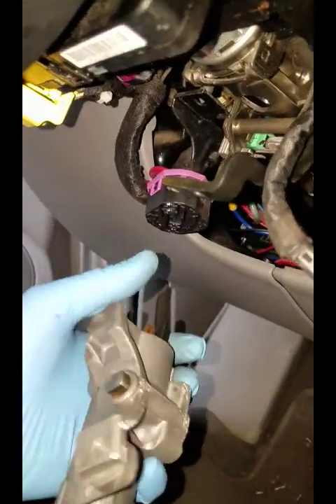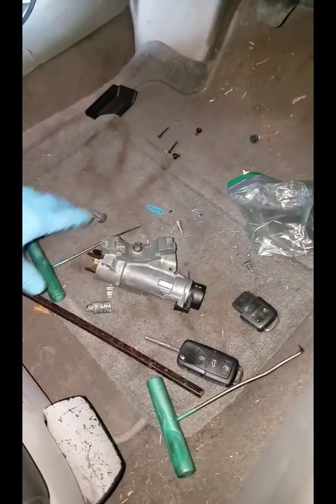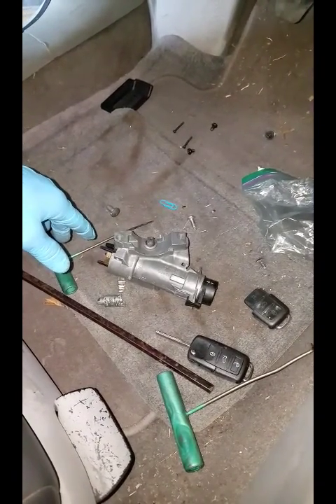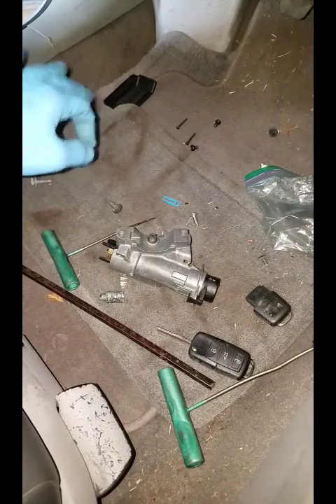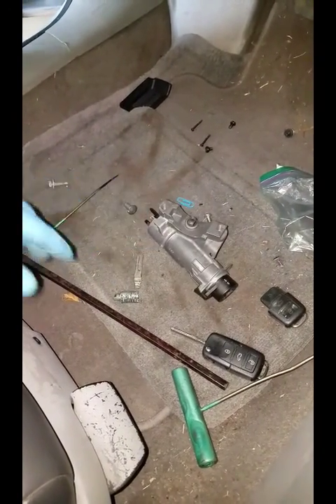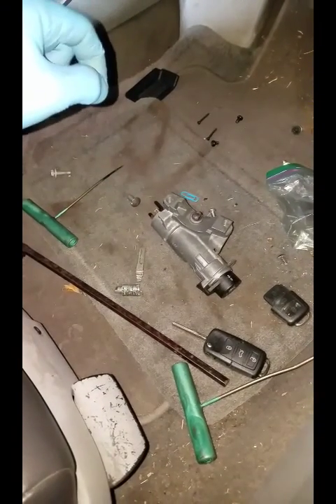Just push down on the tab and it pulls out — that's what's connected on the side right here. The opposite side is just a plug that pulls off, and then you'll have the whole assembly. It's really not too hard to do, but you do have a couple of different options to replace it. The salvage yard option gives you two keys — one for the door, one for the ignition — or you can spend two to three times more to get a new ignition from the dealership. Anyway, I hope this video helped you out. If you haven't already, please subscribe, thanks for watching, and I'll see you in the next video.